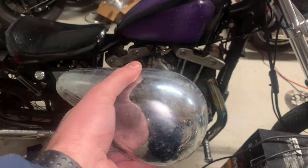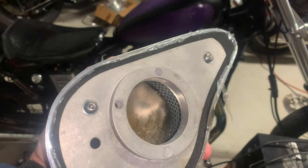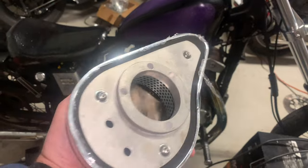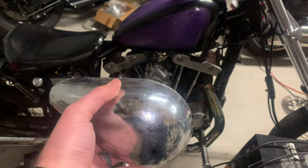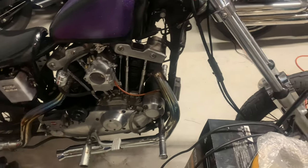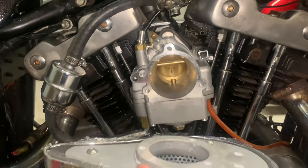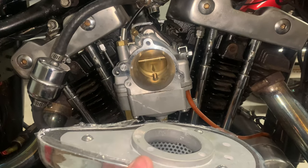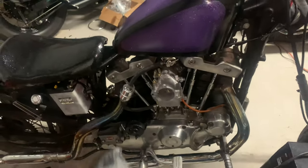This is the smooth one — there's no exposed bolts, they're all hidden on the inside. We also have some with exposed bolts on the outside, and some with a flame design on them. But these are for the CV carburetors for the later model bikes or the CV fuel-injected bikes, whereas this is the S&S carb. So my holes won't exactly line up — I may have to drill some new ones just to make this fit. It should look pretty cool, pretty classic looking.